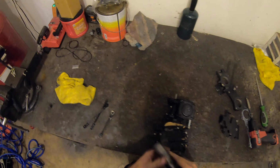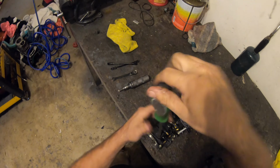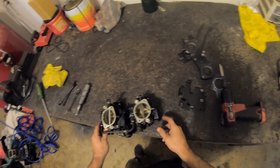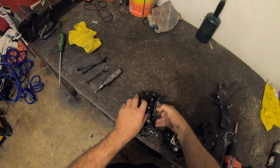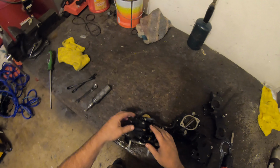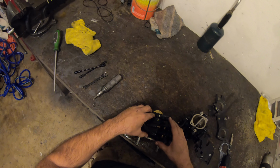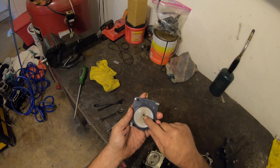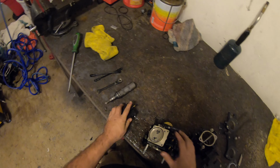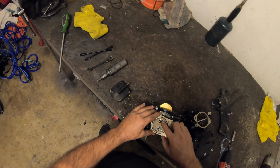This is a lifesaver on carburetors. Alright, front of the carb is the jetting side. The rear of these are the fuel pump block. Pulse comes from the crankcase into a diaphragm. This diaphragm will flex. Flexing, pulsing action will open and close the check valve.